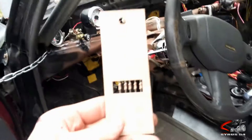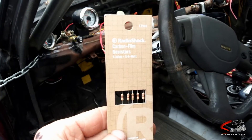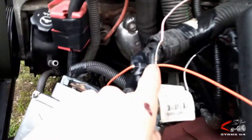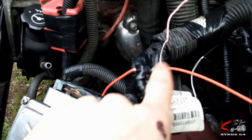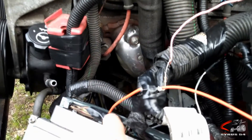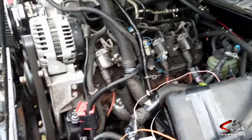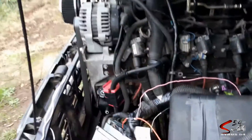As per the recommendation, I went to Radio Shack and got some 1,000 ohm, 1/4 watt resistors. Supposedly what you do is put that little resistor in with the gold facing the plug going into the white wire at the number 10 spot, and run that to a 12 volt ignition source or 12 volt straight off the battery. That's supposedly all you've got to do.